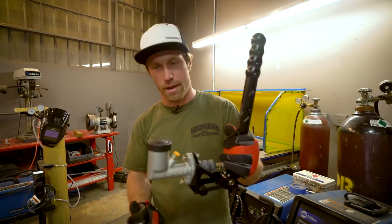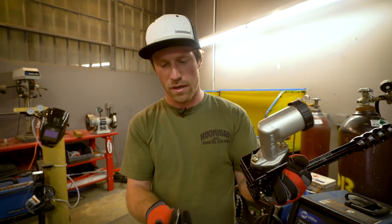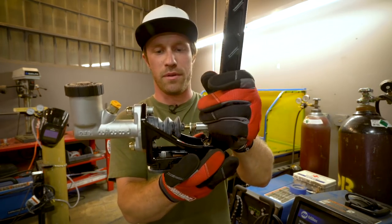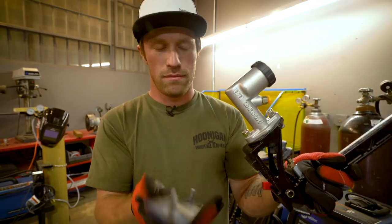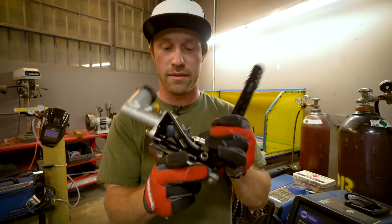So I just finished this bracket for the handbrake, and this is gonna weld to the trans tunnel, but I'm gonna have to reinforce that. What I did was just kind of replicate the shape of what this is, and then weld in two bolts to create studs because I won't be able to access them. So it just slides right on, just like that, and you'll be able to put a nut on top, and this will be removable. Otherwise, you'd have to put these on beforehand and then weld it in, and you wouldn't be able to make it removable. So that's a pretty slick trick if you need to get that done. And now you gotta place it and put it in the car, weld it in.